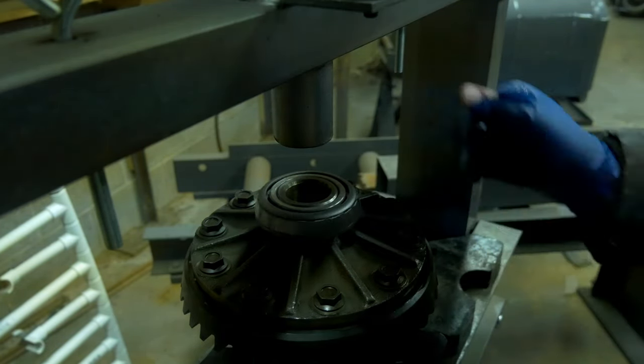And we've got the thick ones, the 8 mil and the 2.45 mil on the right side. And then we've got the 2.25 mil on the left side. Again, your shims and measurements might be different, but if you find yourself in need of changing the shims, do not change that actual overall measurement. Okay, that should not change. If you take 1 mil or a half a mil from one side, you have to replace it on the other side. And then we're just gonna tighten these things down.